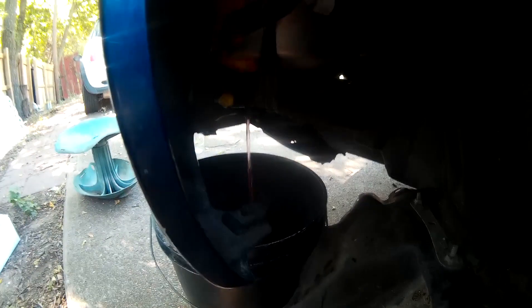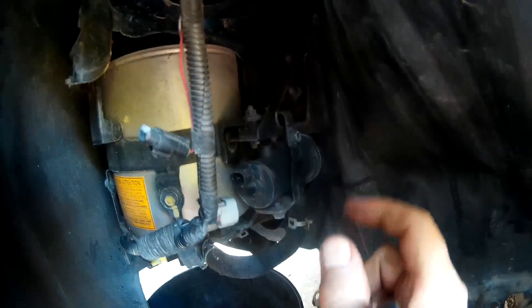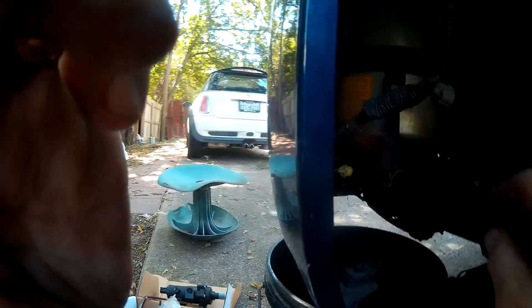The electrical part is out. Sounds like a racehorse. I'm replacing this pump right here — a mechanic said that's what was giving me the 2601 code. Hopefully he's right. It's about drained. I'm taking this main bolt off right here — that's the only bolt that holds it on.